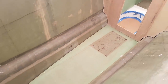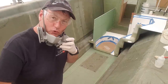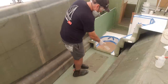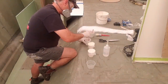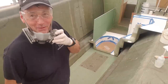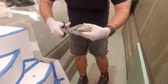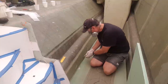Like brand new. First job off the rank this morning — I've removed the bulkhead I set in place to hold the floor down, and now I'm going to put in the filleting compound all around the edges, filling the complete line gap, trying to get the fillet done in one go. I didn't have enough resin mixed up the other day, so this time I'll make sure the fillet is done correctly first time, then rip off the peel ply and get onto the bulkheads. Pretty happy to report there are no squeaks on my floor — do it once and done.